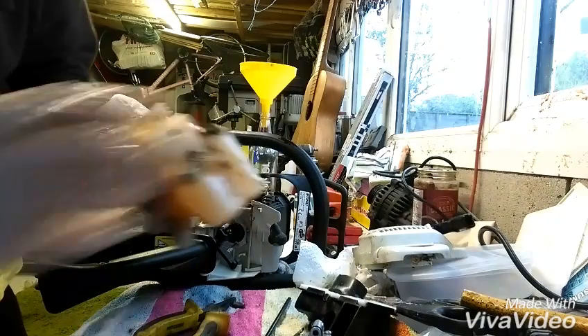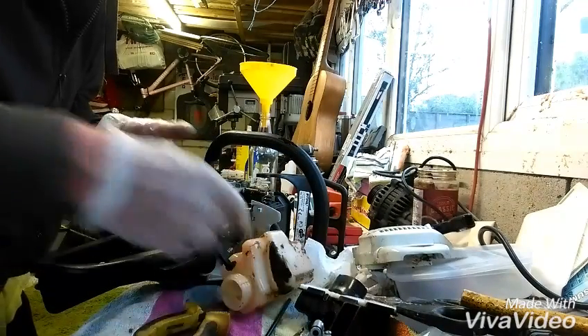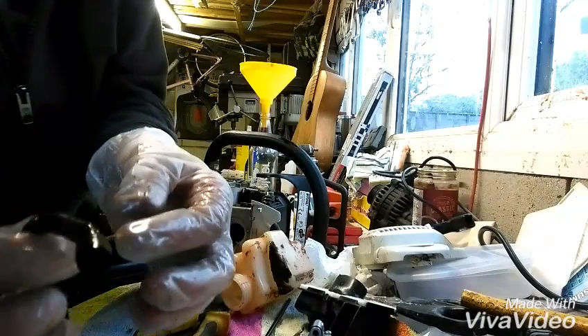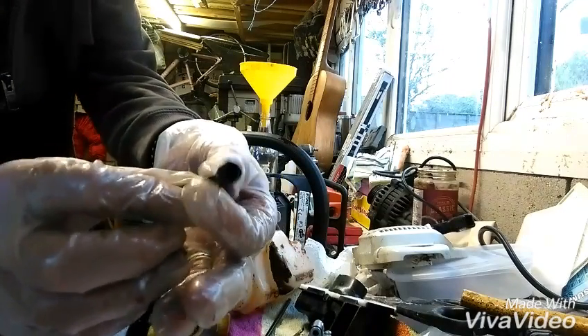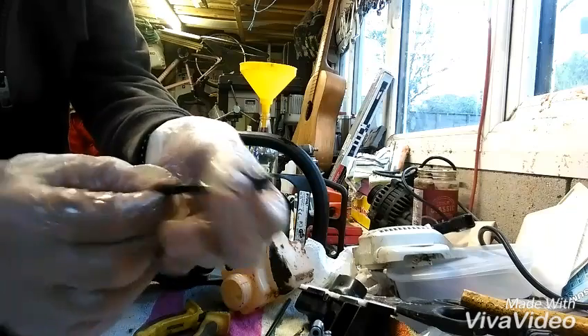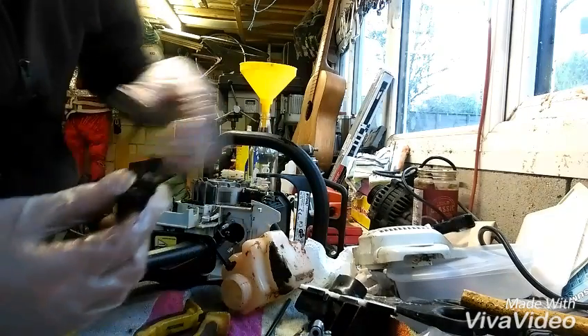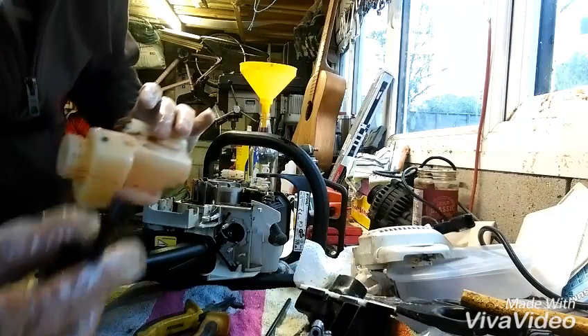Pull that off. And here is the pump - it's not bad, but you can see how kind of thin it is getting here. With the petrol it just kind of eats against it. Eventually it'll start just pouring and be crap, basically. So in which way it went in - it went in that way. So that's got to go back in there that way. My new one - the curly end has to go in there first.